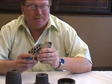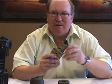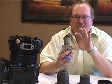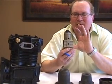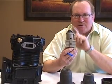Another important step when changing a compressor is to also change the D2 governor. The governor works in conjunction with the unloader on the compressor to make sure it shuts off and comes on at the right time. It doesn't cost much to buy a governor, so why not install one with your new compressor and start out fresh?